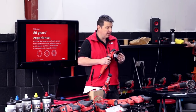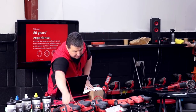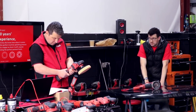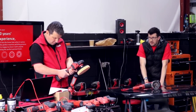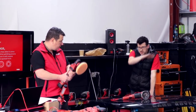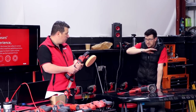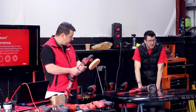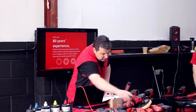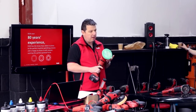As soon as I finish talking, I just want you guys to grab these machines, grab some pads, grab some polish, and have a go. The big breaking news is our cordless tools — we've got the PE42 cordless rotary polisher. The battery technology from our parent company gives a very flat power curve right through to the last 5% of the battery, where it will stop — which gives it enough to remember its charging sequence. You start off with quite high torque, then you've got a very flat curve all the way through. It's the same amount of power all the way through until it stops. We are also the first company to ever launch a cordless free-spinning, or DA, 15mm throw polisher.